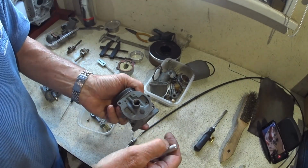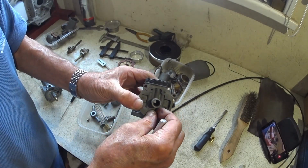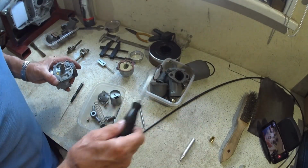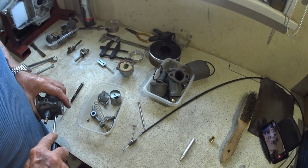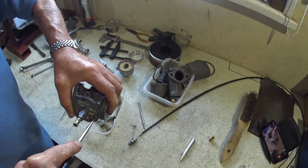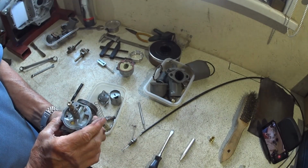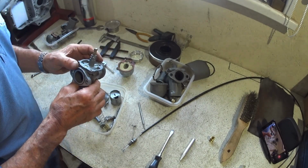So yeah, I've never seen inside there before until I just gave this a bit of a clean up and it just fell out. So yeah, that's scrap. So let's put the pilot jet back in. Again, it's been air-lined, cleaned, whatever, and obviously not too tight, just enough, with a really nice fitting screwdriver so you're not doing any damage. So that now is built up, so we can go for the float bowl.